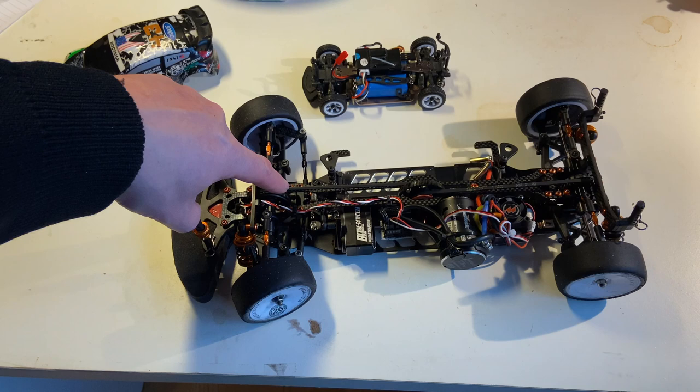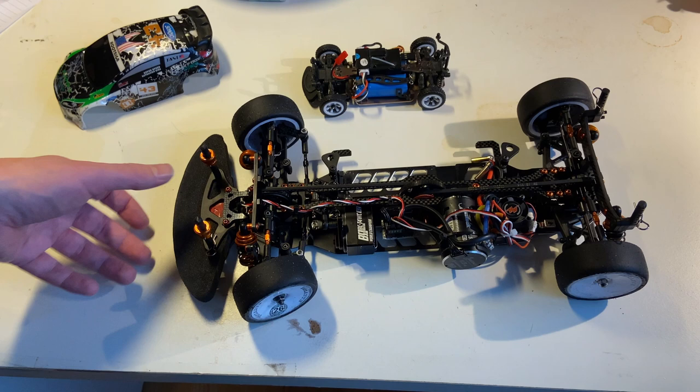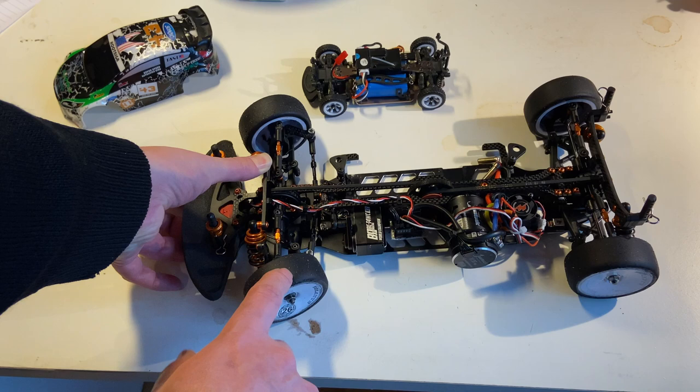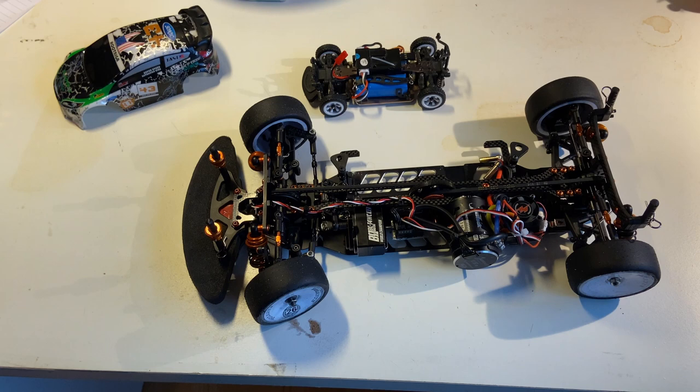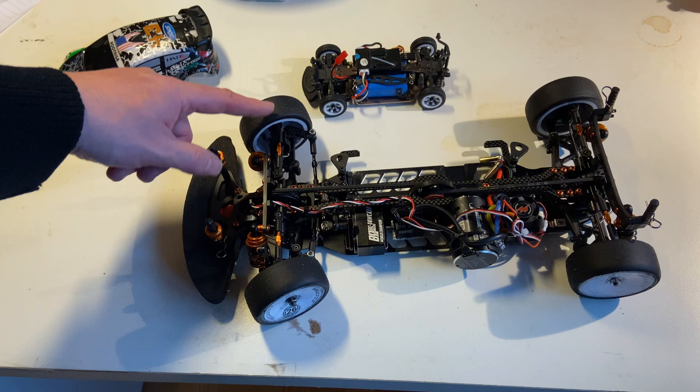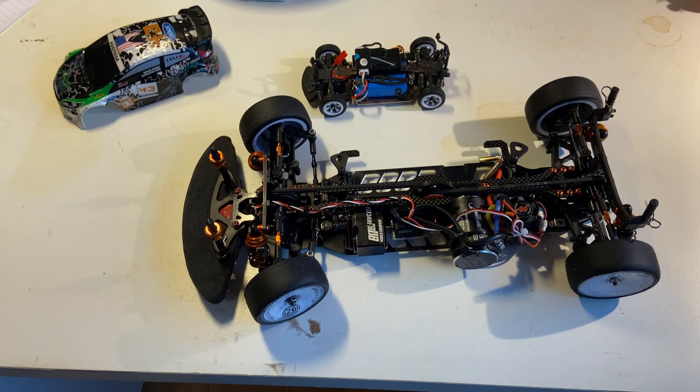The reason we do that is that when we drive around the corners very fast in these touring cars, the car starts leaning to one side, which means there's only a little weight on the inner tire. If we didn't have a lock diff and we applied some throttle, it would simply slip, and all the power would go through the slipping wheel, with not much steering and forward driving force on the other wheel. So by having a lock diff, you can go hard on the throttle when you're going out of the turn. That's one of the benefits of having a lock diff.